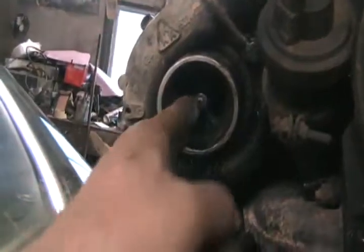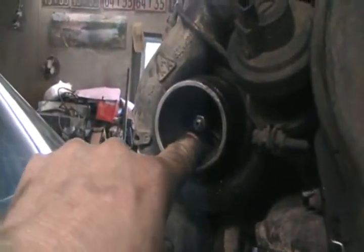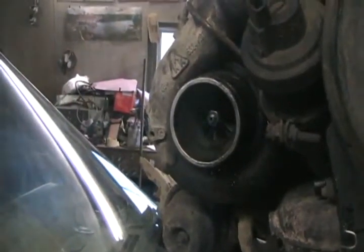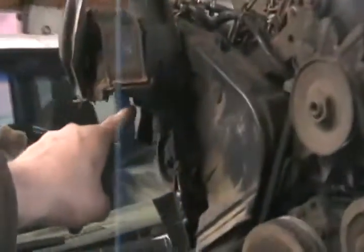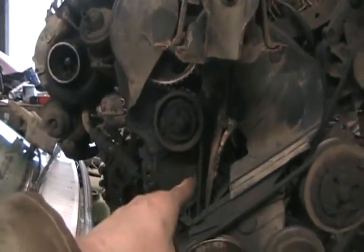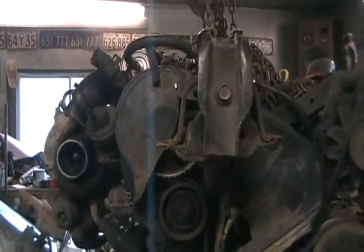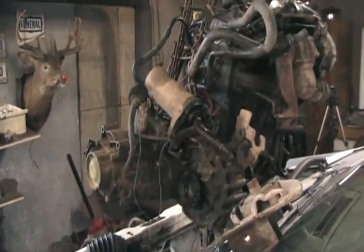And of course it's turbo. That's a good turbo — the way you tell is almost no side play on the shaft, it spins freely, and you don't see grinding marks where the blades have been hitting the aluminum housing and chewing it. And unlike Volkswagen but like Chrysler, I have a Chrysler motor mount going through the timing cover like Chrysler's do. Unlike Volkswagen's, which was very tricky to hook up, as I still had to make it able to fit in between the timing belt assemblies and pulleys, and be able to change the timing belt at the same time. It still uses the VW alternator — they wire pretty much the same as the Chrysler. And of course that's a VW tranny.